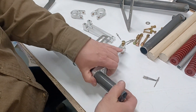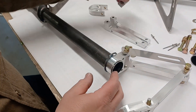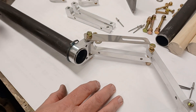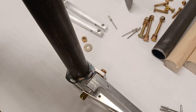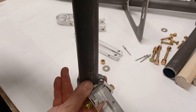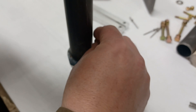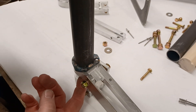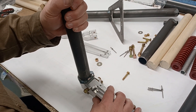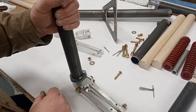The top of the assembly allows you to set your toe-in and toe-out. It looks very similar to the bottom except it slides on the tube. After you've installed the landing gear on the airplane — this is essentially the same landing gear design we've always had — there are two slots, and you put the AN3 bolt supplied through both holes, then snug up the nut underneath. Once everything is assembled, tight, and you have weight on the wheels, you use that adjustment to set the toe-in and toe-out. You want them parallel — no toe-in or toe-out — then lock those bolts down.